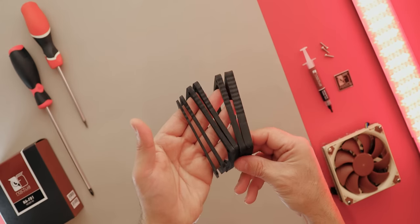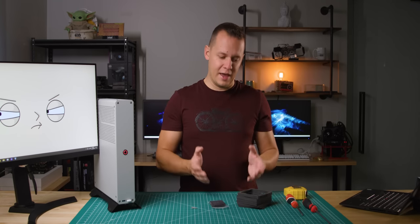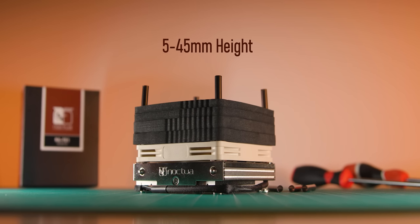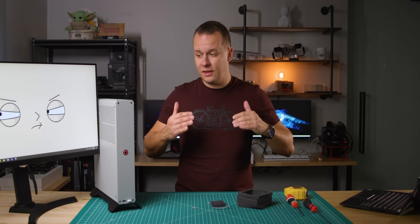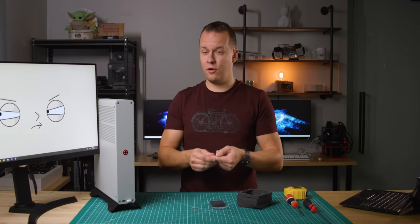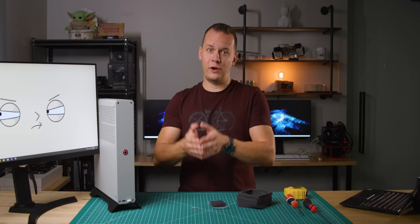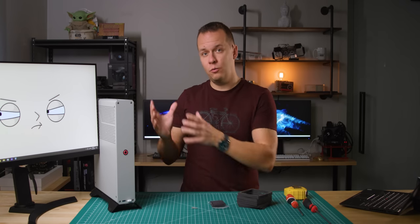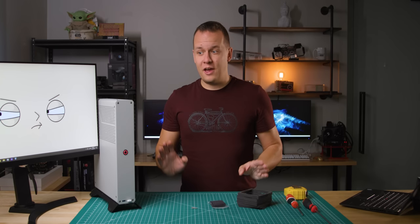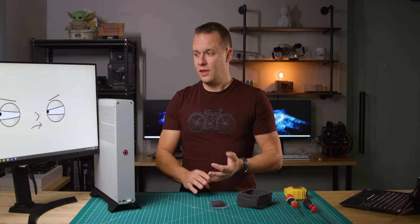The other thing I want to talk about is how you adapt the FD1 to your case. There are seven different height foam adapters, and you can use those varying heights to adapt this between 5 and 45 millimeters, depending on how much space you have between the cooler and the side of your case. First, you need ventilation on the side of your case where the cooler is. There also needs to be direct access between the cooler and that side panel — if a GPU or something else is in the way, this is not going to be for you.